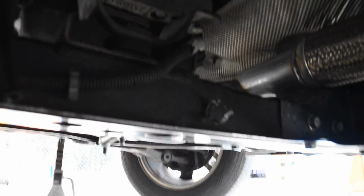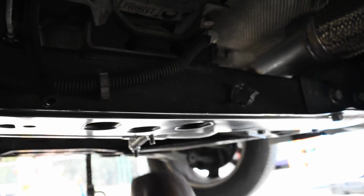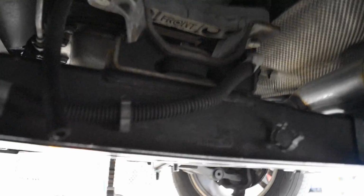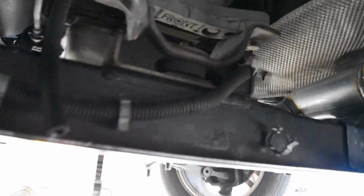Once you unscrew all those screws, then you'll want to get a jack, bring your jack up under the vehicle and lift up your jack, just support your transmission on it. Lift it up slightly, and once you do that, you'll be able to pop out all the remaining screws, and this whole cross member just slides right out. Very simple. It drops down and out your way. You would just have to find something to support your transmission on. That's the most important thing.